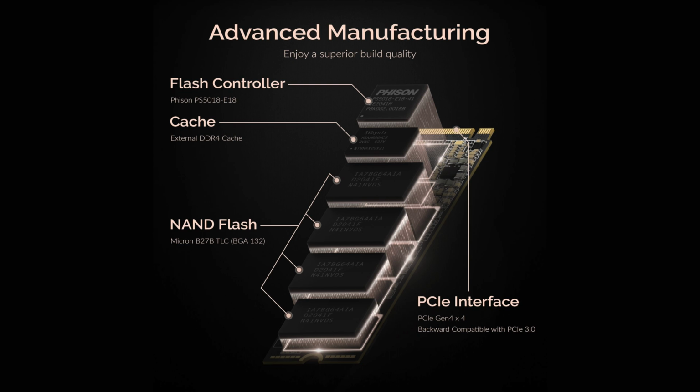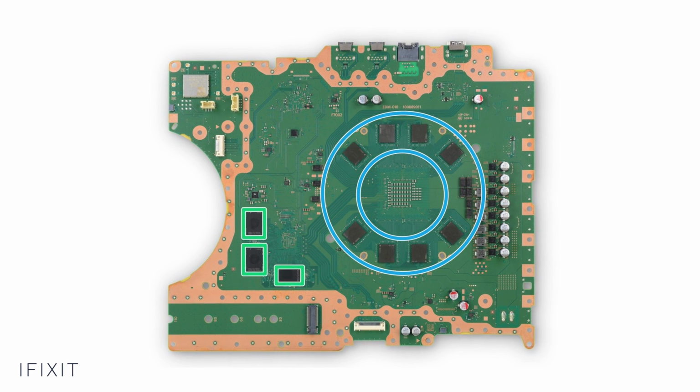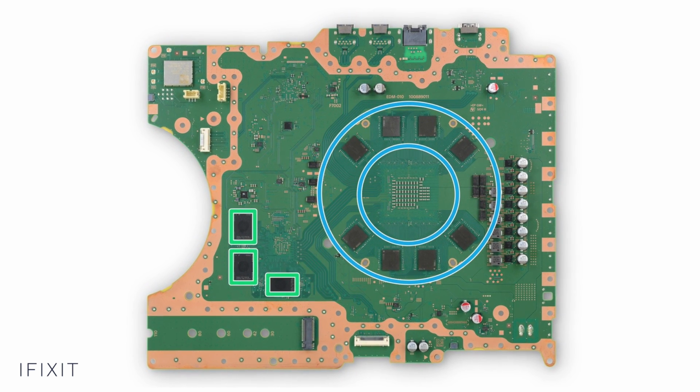Depending on the amount of storage you have, you may have NAND storage on both the top and the bottom of the SSD. Now, looking at the PS5 itself, on the motherboard where the PS5 has the NAND chips, there is actually no heatsink or active cooling, which further cemented our theory that the NAND doesn't get hot enough whereby you need additional cooling after long periods of gaming sessions. Again, read operations don't generate as much heat as write operations. This means that cooling the controller on the NVMe SSD is more important than cooling the NAND.